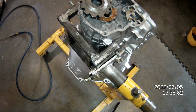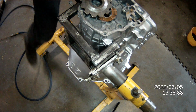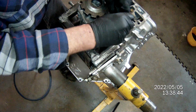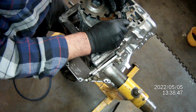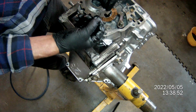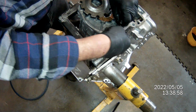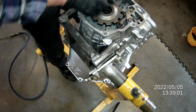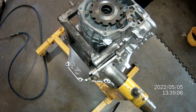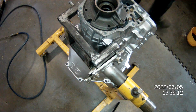Okay. Park ball. Drop that sucker in. Oh, wrong way. Right there. Spring goes in this way here. Fits in that little groove. Push this down, run it back, push this and hook that on the lip. That goes there. Cover. So this is going to be a race transmission. Now the governor tubes you worry about.